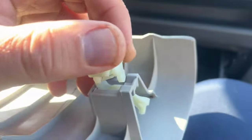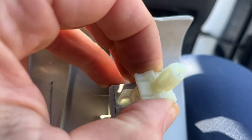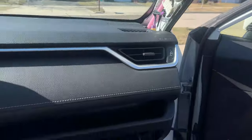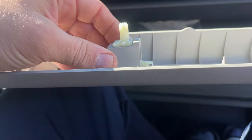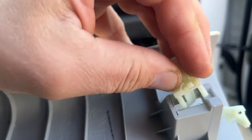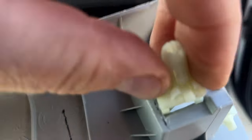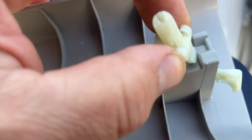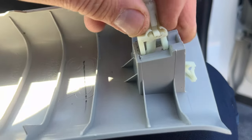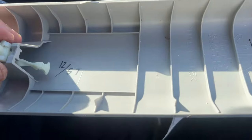There's a pin here. To remove this you would have to press on these pins — one here and then push on these pins right here — then you can remove this panel. When you reinstall it, just push it through like so and push it in until it clips into place. You need needle nose pliers to push on those little pins on the side.